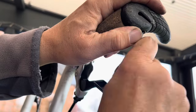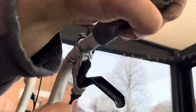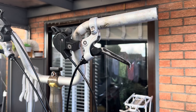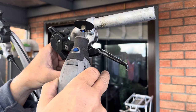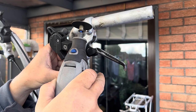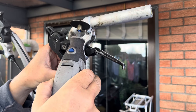On to the front of the bike and the handlebars. I have a separate video on the channel for removing handlebars if you need more detail. I did have one issue: one of the bolts on the brake levers was rounded off. It was a titanium bolt I fitted two or three years ago — I may have over-tightened it. I cured that by cutting a slot in it with a Dremel tool and a grinding disc, which enabled me to remove it with a flat-bladed screwdriver.